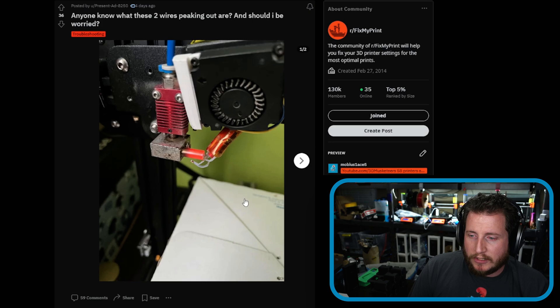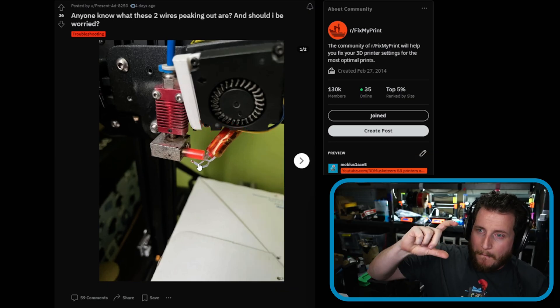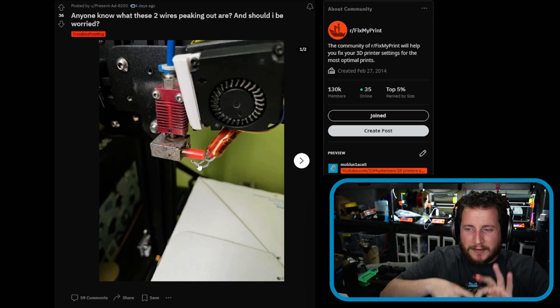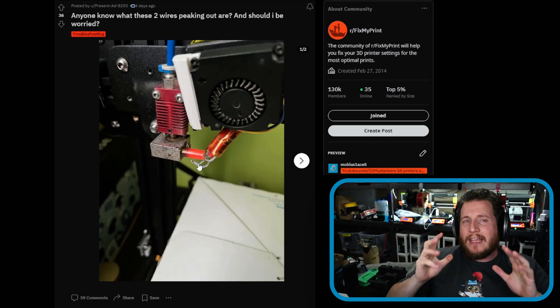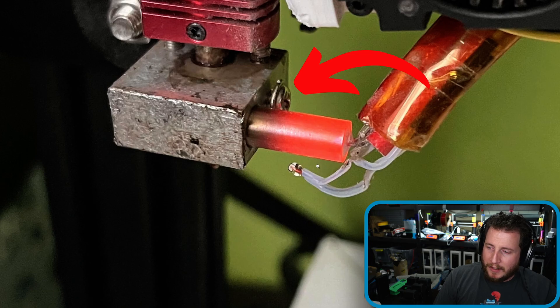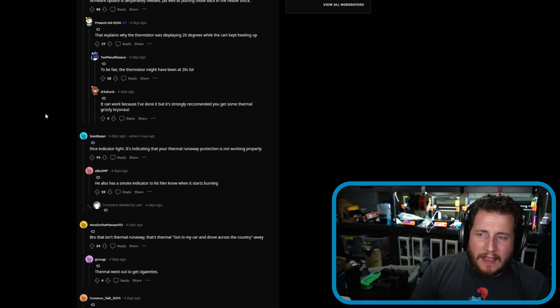This printer is not in good shape and needs a fair bit of work. The screw for the thermistor is still there — power the machine down, put the glass bead in, put the wires in, and the screw and washer grab the wires. Do not over-tighten or it will damage the hotend. You can see the screw and washer pulled out slightly — that's where those wires belong. The wires appear damaged from being over-tightened previously.